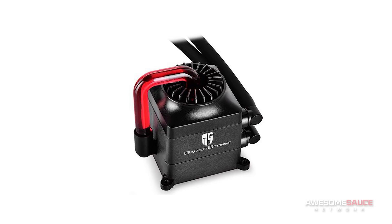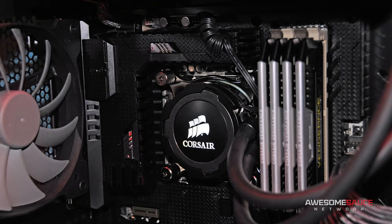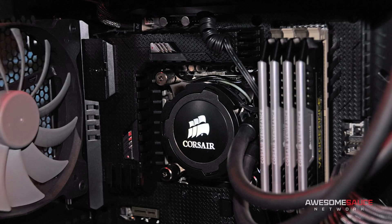Other componentry in the loop like the pump or even the liquid itself can potentially create audible noise depending on the cooler. That being said, liquid coolers have a few tricks up their sleeve, such as using software to create a fan curve — tuning it allows you to gradually ramp the RPM of your radiator fans based on CPU temperature, or set max RPM parameters to ensure fans never exceed a specific audible target. If your cooler and software allows it, you can even tune the pump speed curve. Of course, if the pump runs at a fixed speed, you could be at the mercy of its noise level. Overall, advances in software control and pump design have leveled the playing field enough for both sides to be capable of near-silent operation, making this round a wash.